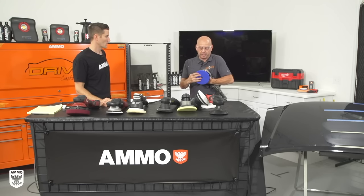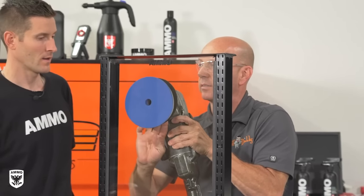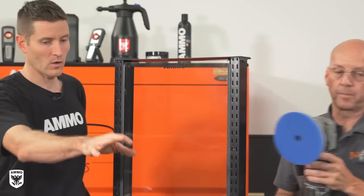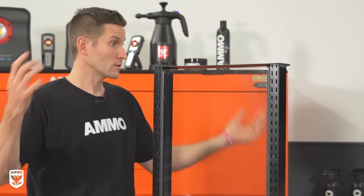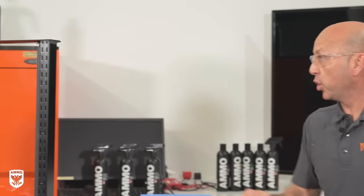With the orbital machines, we made polishing a lot easier, safer, and lighter — anyone, even a weekend warrior, can pick one up, put on a variety of pads, use a variety of liquids, and get a pretty good result. The stalling actually provides a margin of safety — you come over an edge and it's not steering you around; it stalls for a reason to keep things in control. Then we moved up to gear-driven, which is like smashing the rotary and orbital together — a hybrid where instead of stalling, it blasts through, but the orbital motion means it's less likely to burn through.